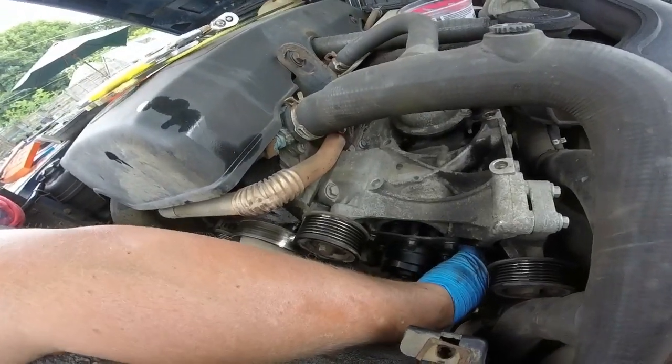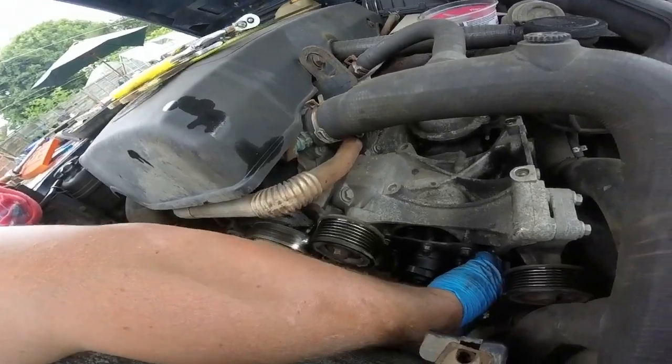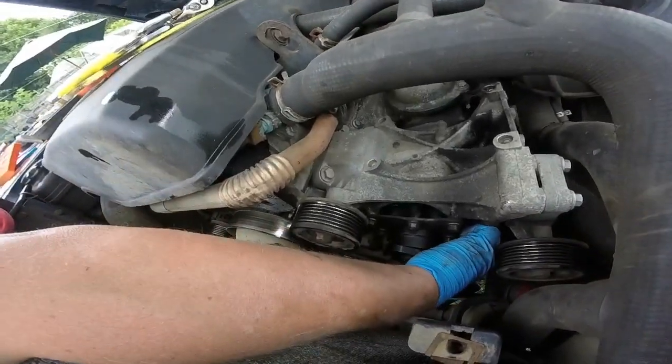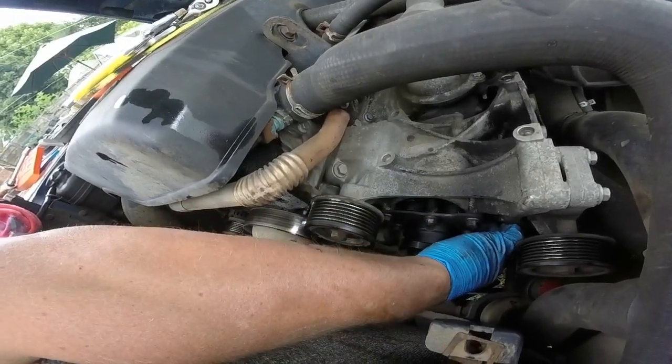I remember years ago I was doing a cylinder head. I was nearly at the end. I was putting an injector back in. It was on a Volkswagen. And I over tightened the injector and cracked the head, so better not overdo it on this. It's only into cast aluminium, so I don't want to strip the threads.